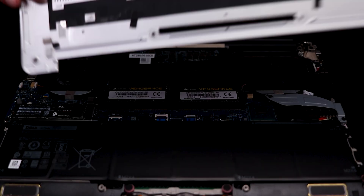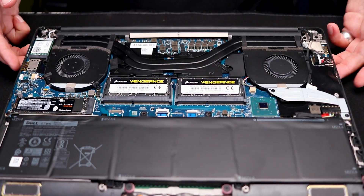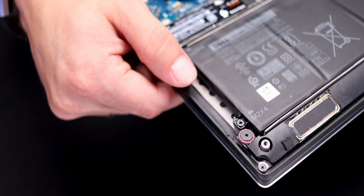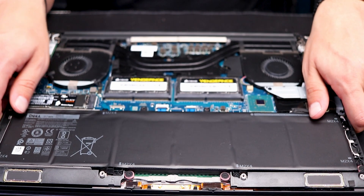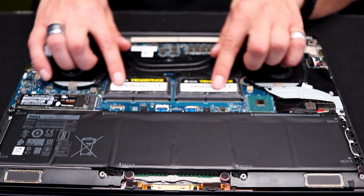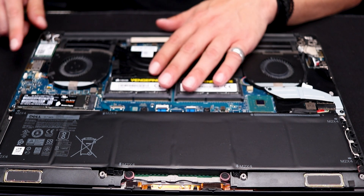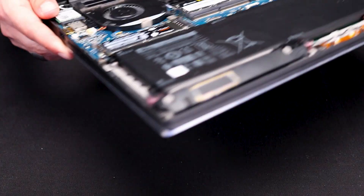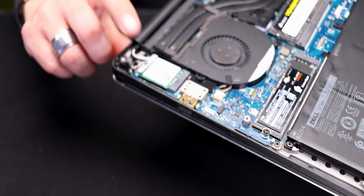After you remove the screws and the back plate — every laptop is a little bit different — the MSI for instance had a whole bunch of clips on the side and it was so hard not to break them. If you do break too many of them you'll see that gap and it will bother you. Now what you'll find inside the laptop is there will always be an M.2 slot, there will be two RAM sticks where one might be soldered on and one might be changeable, and then a Wi-Fi card. I've already made a video on replacing the Wi-Fi card and reconnecting the antenna, so I'll leave that link below.